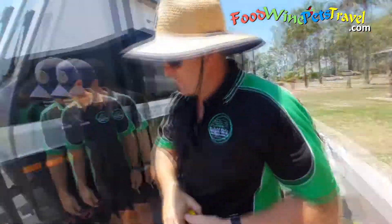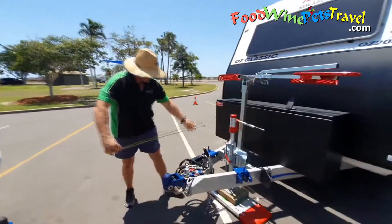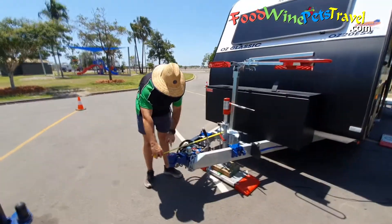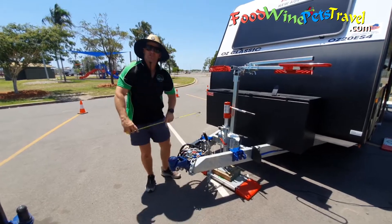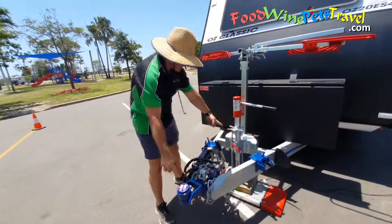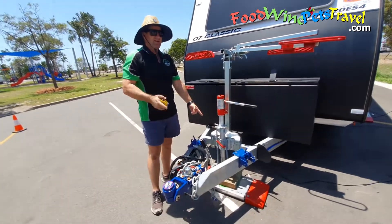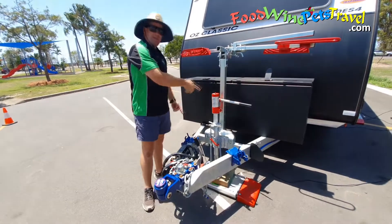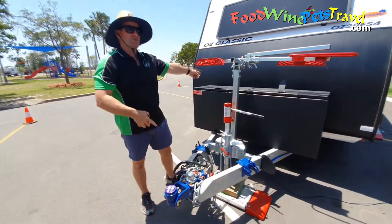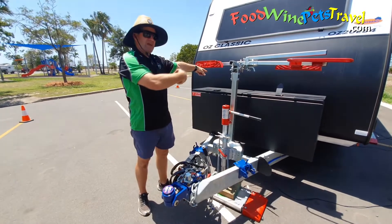We've moved the weight from the tow ball — let's say that is 830 millimetres. If you measure from a metre from where the weight's imposed, you've got up to a 50 kilo discrepancy, which is huge. Now it's obviously going up because that weight is closer to the water tanks that are full, because the water tanks are forward of the axles.